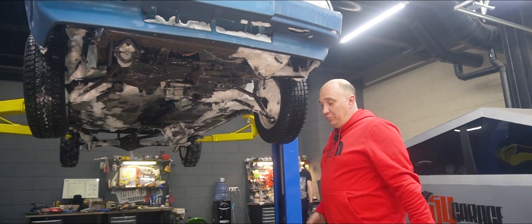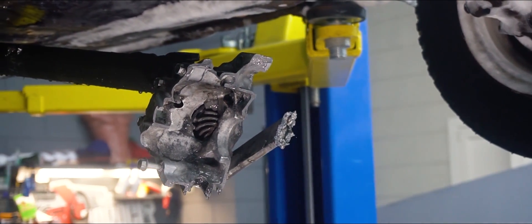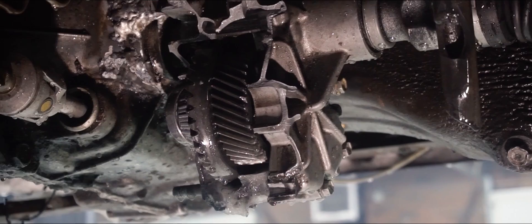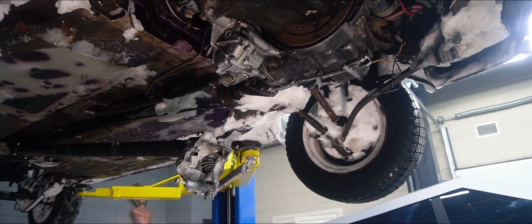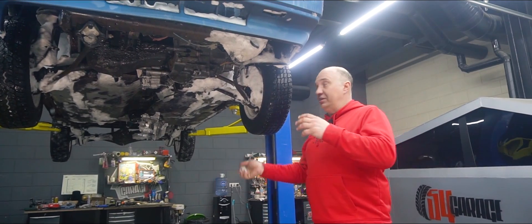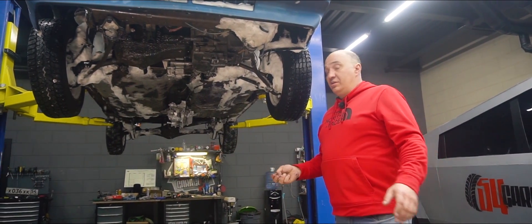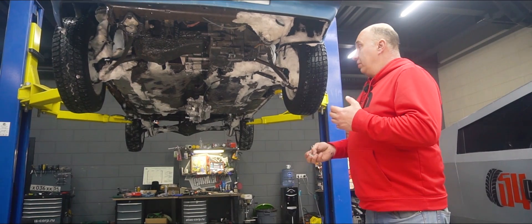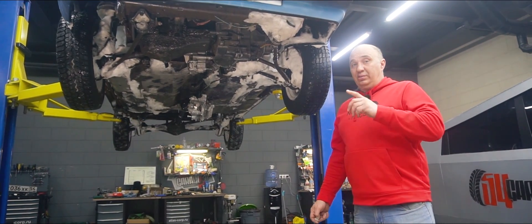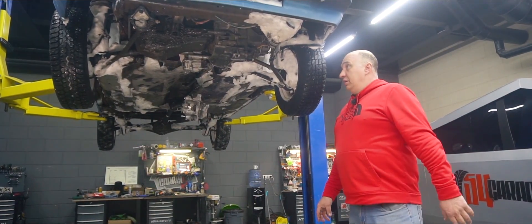Here's what we're looking at, fellas. We just brought the car in and got it onto a hoist, and here's what's broken. This piece of the transfer case housing which we added onto the car has taken a serious beating. The teeth on the planetary gear are completely rooted, so yeah, at the end of the day the transfer case let go and blew to pieces. I see a few reasons why this could have happened. If the rear diff hadn't been welded up, this transfer case wouldn't have been under such tremendous load and would have happily continued living. As for the other factor — it was all good while we were running normal tires, but as soon as we installed those tractor wheels, all of a sudden the rear axle had lots more grip, which increased the load on the driveline. And due to that increased stress, the transfer case grenaded.